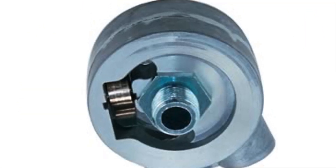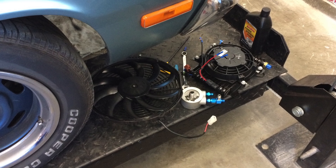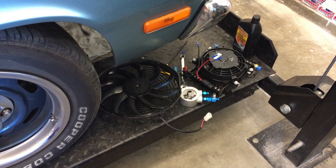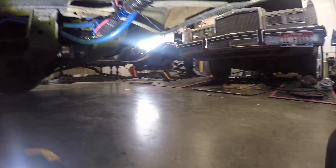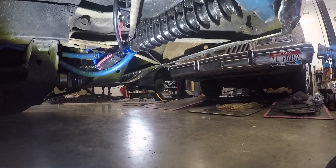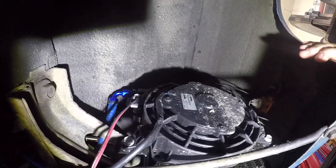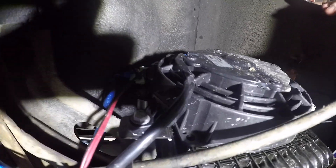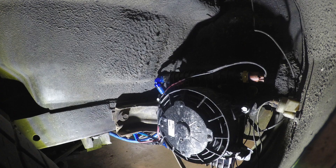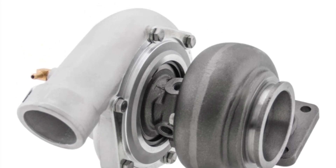Since doing Route 66, we've also added an oil cooler made by B&M - a small cooler, fan, and thermostat package. This one is not controlled by the ECU; it's just an auxiliary system. The sandwich adapter at the oil filter also has a thermostatic valve that controls how much flow goes through the cooler. Once you reach operating temperature, all of the oil flows through the cooler, and when it reaches a high enough temperature the fan kicks on.